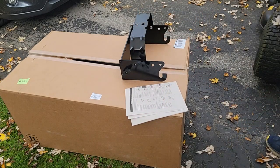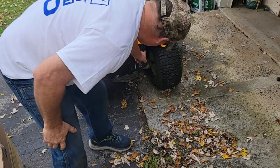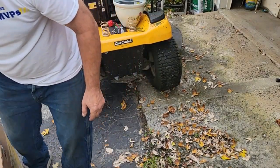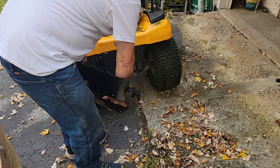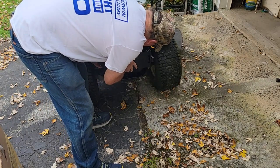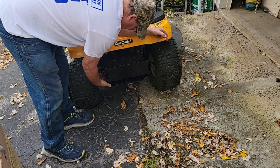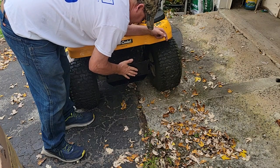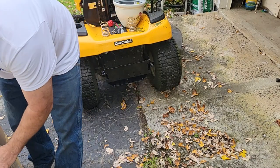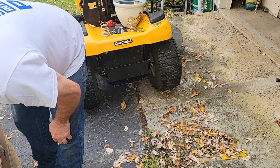We'll look on the tractor — the brackets are already on the tractor, nice shiny ones. So this unit comes in like this, lift it up and drop it down. Then the clevis pin — the reason they want you to keep it loose is so she can mount a hitch pin here. It gives you another hole so this bagger doesn't have to come off to be able to haul her garden cart around. That's kind of nice — she's got a garden cart to pick up brush, whatever.